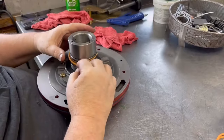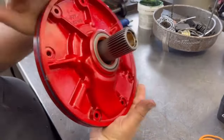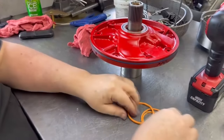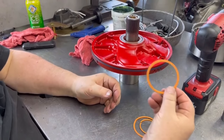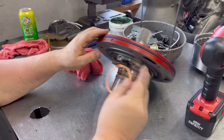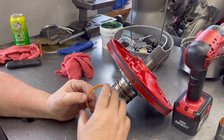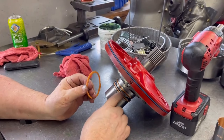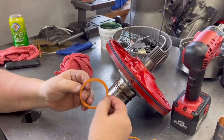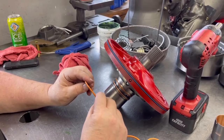All right. So John has put the front pump together. And nice, pretty, nice and red. John, what's the difference between these and the factory ones? These are sealing rings, and they seal the high gear drum and the forward drum. And in high pressure applications, the steel clad seals that come on there can wear out very quick because they're pushed. Where the Teflon sealing rings, they'll basically last forever. They don't wear out like the steel ones do.